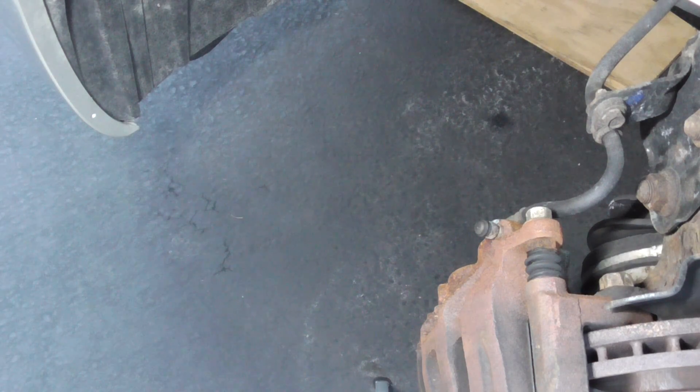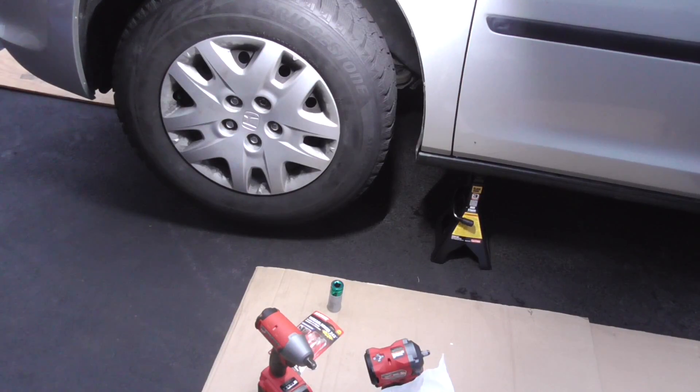So far it's tough to gauge which tool has more power. I'd think the half-inch compact with the larger anvil is hammering a little harder than the stubby, but performance-wise they're both getting these jobs done with relative ease. I'm just going to finish these off with the 22-millimeter on speed one — about 60 to 70 foot-pounds of torque each. I'll do two with the mid-torque compact, two with the stubby on speed one, and then finish it off with a torque wrench and conclude the video.